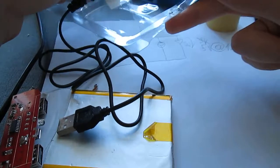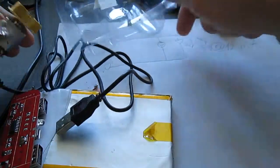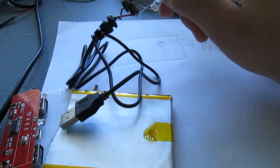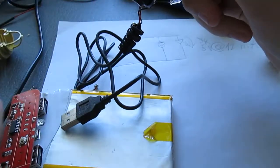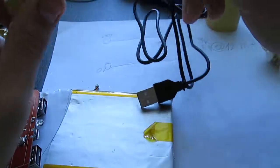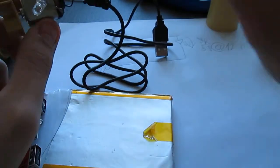but actually touching this now, I am feeling that the motor is getting quite hot, and that is also a concern with a device that is especially designed to suck in dust and therefore obstruct the airflow through it. Although I suppose these grills could help somehow, maybe, I don't know. But what I do know is that apparently, since there is no current limiting resistor on the LED, they're kinda relying on the resistance of the lead. I'm not convinced by that, but they do sell these.